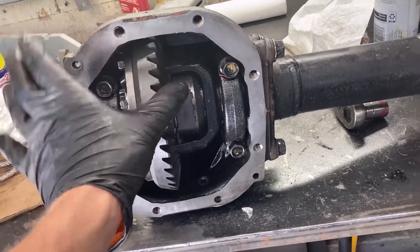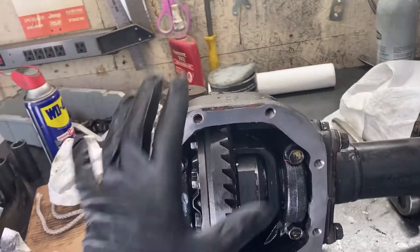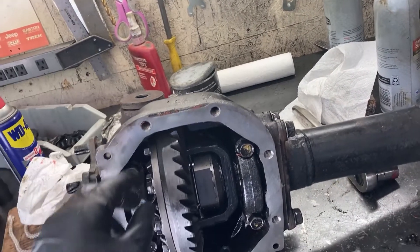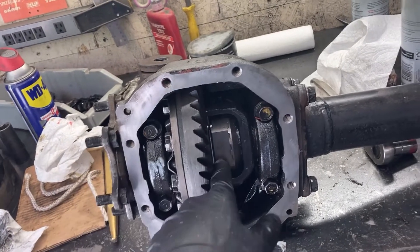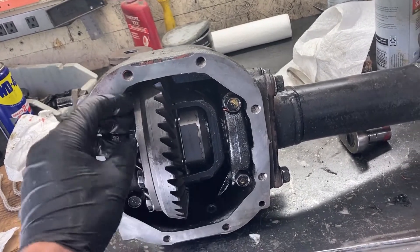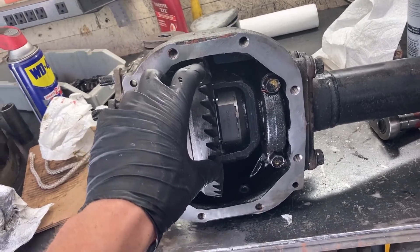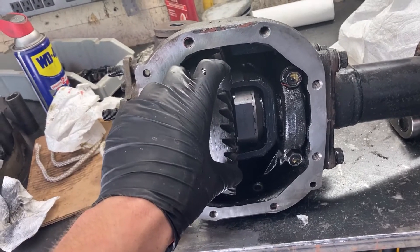When you're in two wheel drive and have the hubs still locked, so the whole front axle is locked up and not connected to the driveline, no issues there, super easy to steer. And I had no issues breaking axles or breaking other parts with this. I was on 31 inch tires though, so your results may vary if you're going bigger than that.